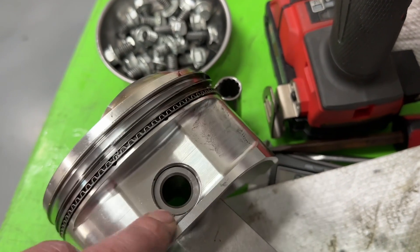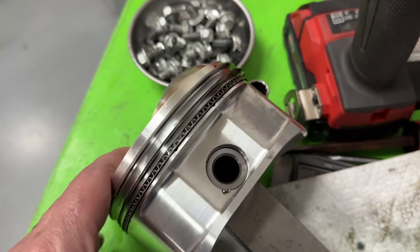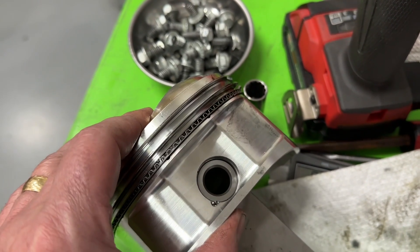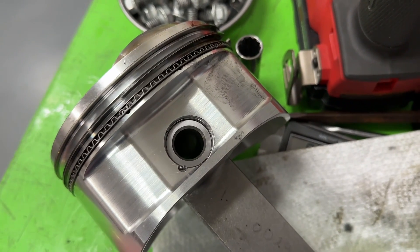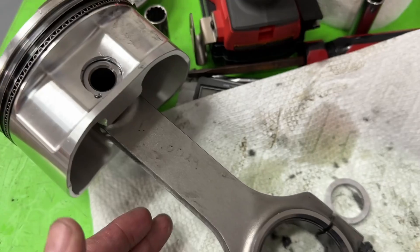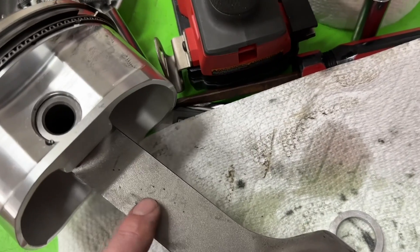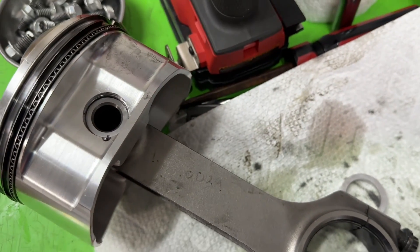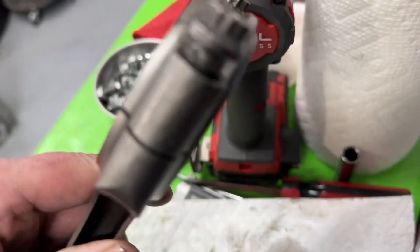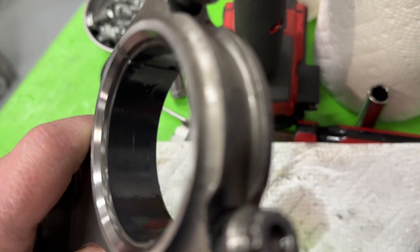The other thing for the power adder deal is the wrist pin. This is a small block Chevy diameter wrist pin, which is a smaller diameter than a big block Chevy. This same pin is now supporting a piston that weighs more than any small block Chevy piston I've ever weighed — it's super heavy given how much material is there. It's supported by that same thin pin. So definitely not good for use with a roots blower. The rod itself probably could take it — this is a 6250 rod, a SCAT rod with ARP2000 cap screws. The rod clearance on this one was 2.9 thousandths. The bearings are coated — they look black because they're coated. Very little wear marks, everything looks pretty good. There's one little groove through the center but that's not bad. I love coated bearings — definitely the way to go.